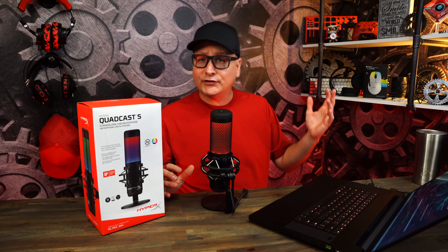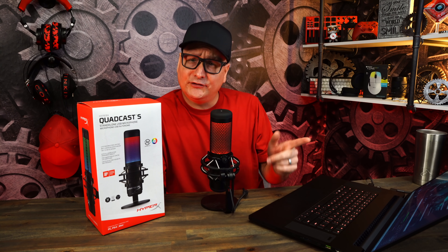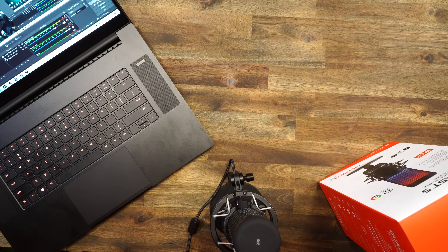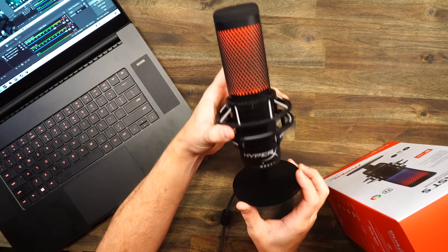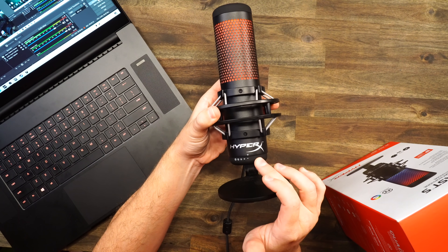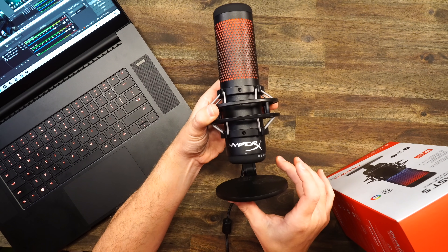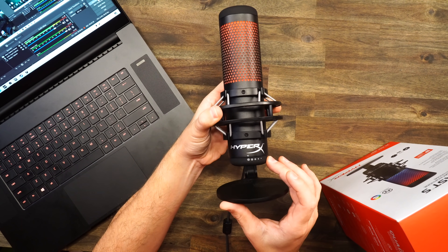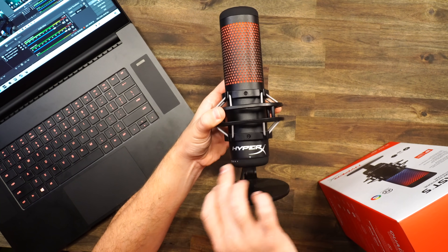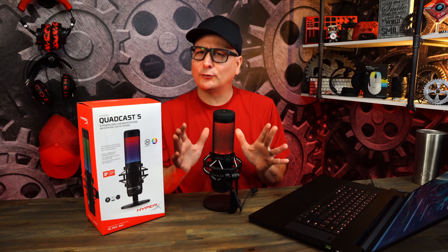You're pretty much hearing the microphone now. If you talk right up on it you're picking up a lot more and it's jumping into the red. Scooch back and it seems pretty good. On the HyperX Quadcast you have this little gain wheel — you can tone it all the way down for much quieter, or crank it all the way up for quite a bit louder. The weird thing is the dots on the gain wheel — it always overshoots them, all the way in front and all the way in back. That's always thrown me off.